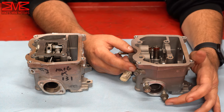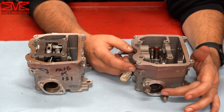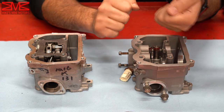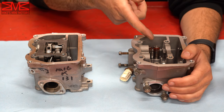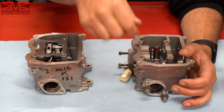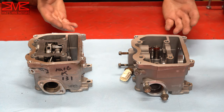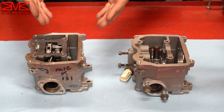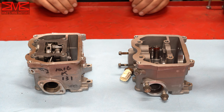We've got this 10mm bolt here — I'm not sure but it might be a drain for the cooling system. It has a copper washer so make sure to move that over too. Then you have your exhaust studs, which are pretty easy to take off. Take one nut off one, put it on the other, lock them together with wrenches, and then use the tightened-together nuts to back out the stud. Now I just need to do the internals — I'll try to get a better top shot so you can see in here.